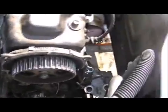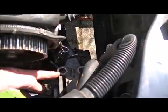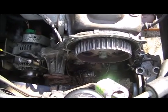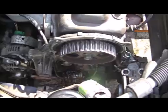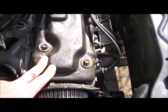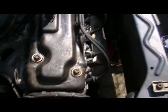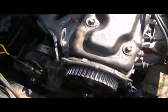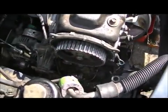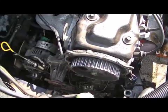followed of course by the belts for the alternator and the water pump, and the belt for the power steering pump. I'm going to follow the procedure as described by the workshop manual, Suzuki's own workshop manual, which will include also that I have to open up the cylinder head, loosen up all the valves, and reset the valve lash when I have finished replacing the cam belt. But it is absolutely required that I have a camshaft, sorry, that it's turning loose freely.